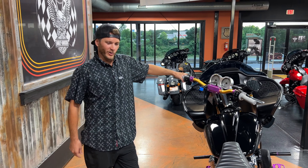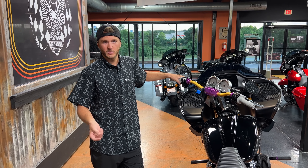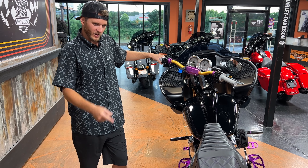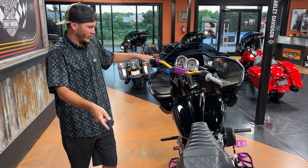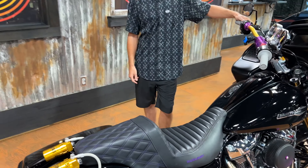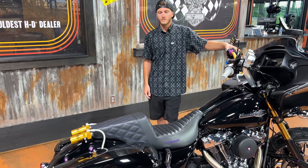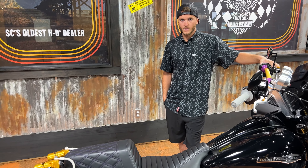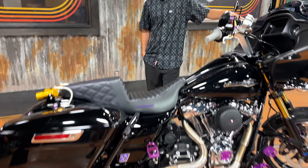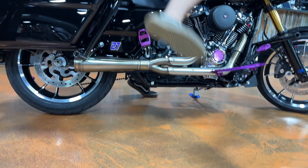I rode my buddy's in Daytona — that's what he ran. I've run the Legend stuff before and I'd rather pay a little bit extra to get something I know how it's going to ride. I'm pretty short but I've got the rears at 14 and a halves, 14 and a quarters, and the fronts are two and a half overs. That's something I talked about in my last video — suspension isn't always about looks. It's functional, more rideable. Sitting it up gives you ground clearance, which you can see here, and that's beneficial for his riding style.